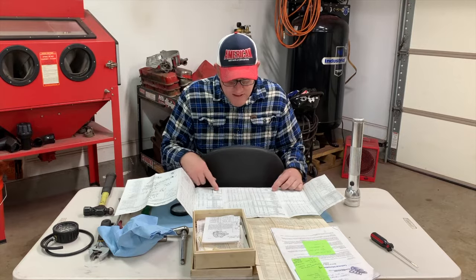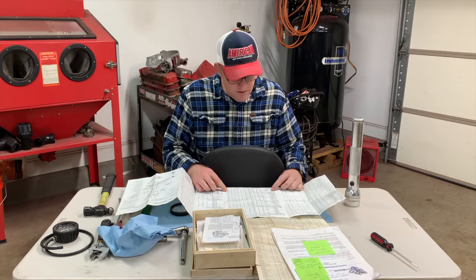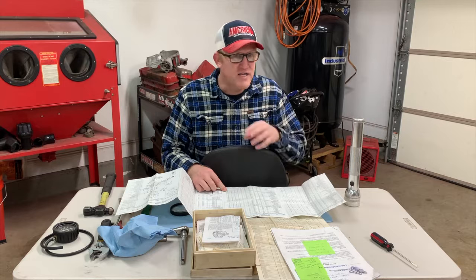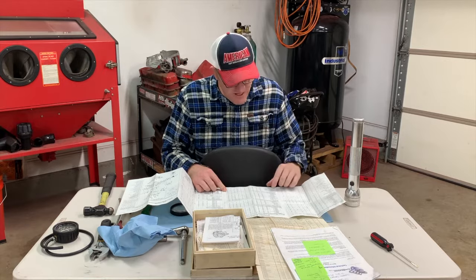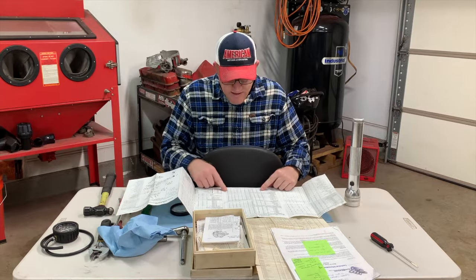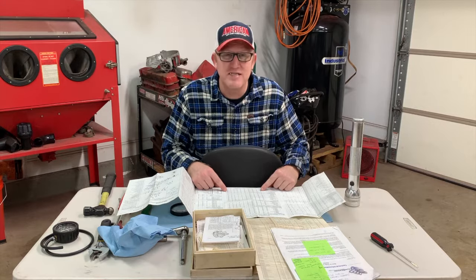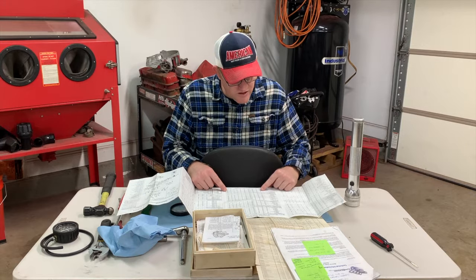It gives you all of your specifications to get the carburetor dialed in to begin with so that you're within the ballpark. Now we did these yesterday to get the carburetor, like I said, within the ballpark of the choke adjustment. Hopefully it's better than that on drivability. But for the choke adjustment, it lists out everything that we needed to know, and we set it originally to the factory specifications because that's the metering rod and jet combination that we went with initially.